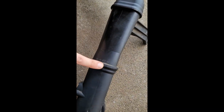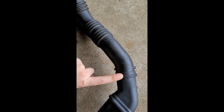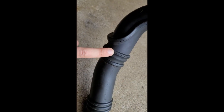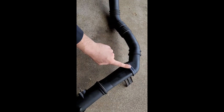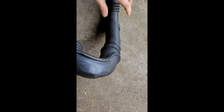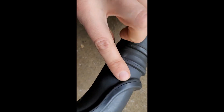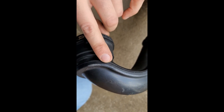With the hose out, you can see there's a seam here, a seam there, and one as well — the rest is all one assembly until you get all the way down here, so it could also crack around this one. So there are one, two, three, four other places the crack could be. I'll show you the elbow and where it usually cracks, and where you're going to want to apply the sealant.